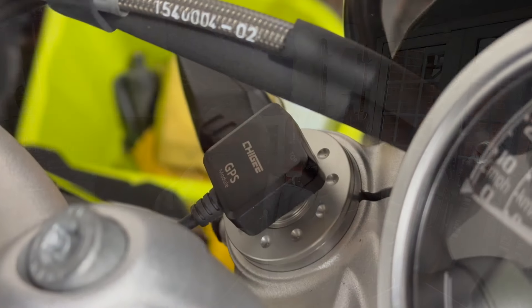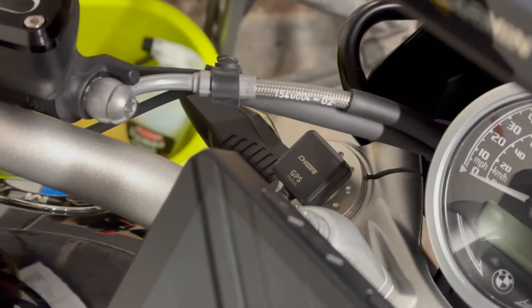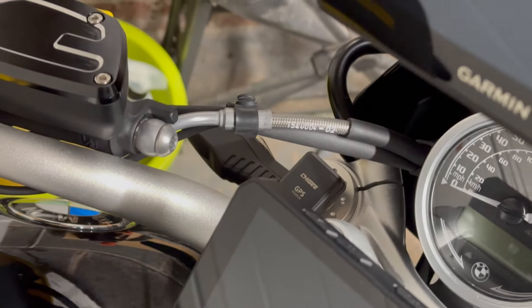Do that very carefully — don't just jam the mounting screw through because you'll crack it. Drill it out very slightly and it'll set up nicely. You can see it's mounted on my bike; it's nice and robust now. The GPS aerial — I think in the next iteration they'll hopefully build it into the actual device, because at the moment it's cabled separately to a small receiver, meaning you've got that separate GPS mounting somewhere. So in all, you've got quite a lot of cabling to manage.